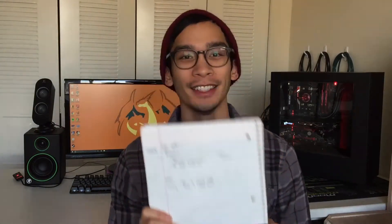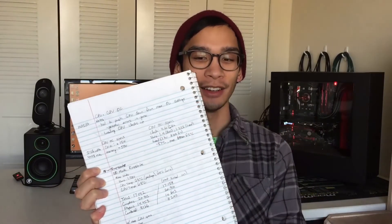So to summarize: my i7-6700K is overclocked at 4.5 GHz with a V-core of 1.332 volts, and my GTX 1070's core clock went up to 2126 MHz with a memory clock of 4506 MHz. Pro tip number one: write everything down. I wrote every single test, all the different iterations of clocks, voltage, and the corresponding benchmarks for each level. Pro tip number two: when you increase voltage, your temperatures will increase — make sure your fans and CPU cooler can handle it.